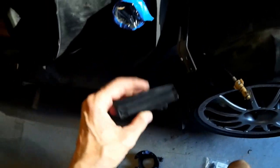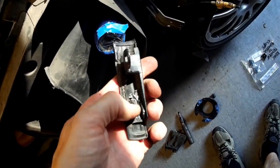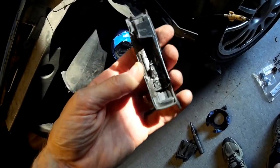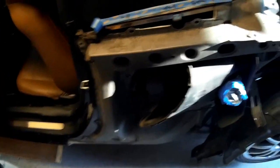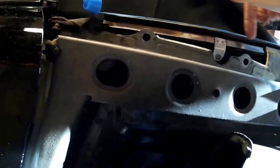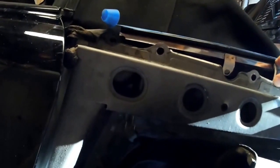This little piece up here, sorry I missed that one, on top of the fender up here, sits like that. It's got one screw and it has one little nub, and mine was glued to some nasty glue that was really hard to pry off, but there's not much holding it on, just that one screw, and the rest should just pry off, and that just sits right up on top there. The last piece that's tricky is these two screws here, that one and that one. There's a metal piece that I've taken off. This is the one I ground the three, what the people are calling rivets, from the top, and left it on the car, took the fender off, left that piece here. Well, that piece really should stay with the fender.